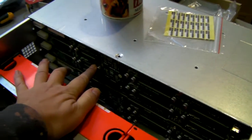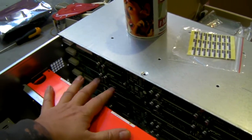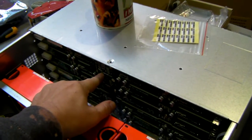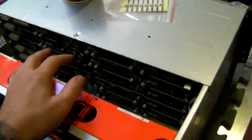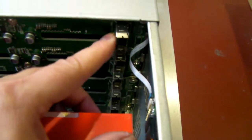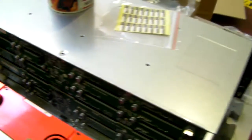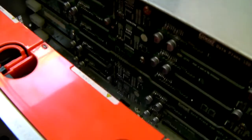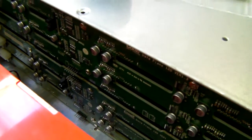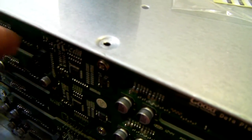The drives themselves can be SATA, SAS, or SSDs. As I said, the caddies will take 3.5 inch and 2.5 inch drives. The backplanes — there are two of them for the 24 drives — each one has got three mini SAS connections and is powered by three Molexes. Depending whether you're using an HBA card that supports SGPIO or not depends on the jumper settings. If you're not using an SGPIO card, then simply remove the top jumper on each backplane and that will disable the SGPIO.